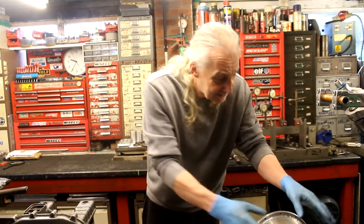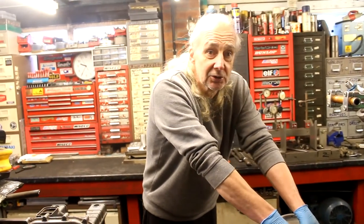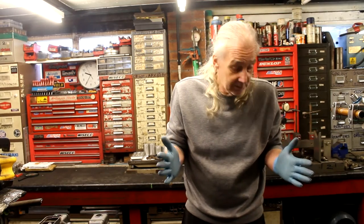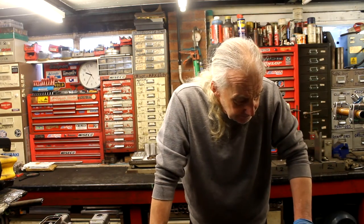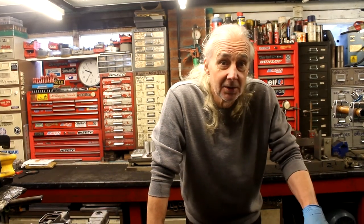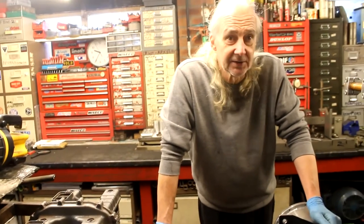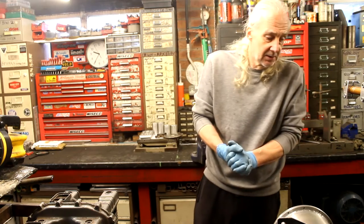The odds of trying to find B&J components now - I don't know whether they use any automotive components, but I would imagine they do to save money. You're talking big car industry manufacturing by the hundreds of thousands. Right, in case someone's wondering why make your own gearbox - on a drag bike that produces a lot of power, even a modified standard gearbox will break, particularly when it's got a big slick tyre on the back. To really punish one you'd be shoving at least a thousand horsepower through it. So that's what you've been up to.